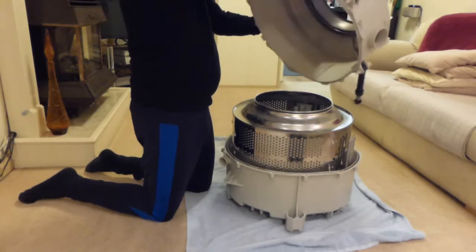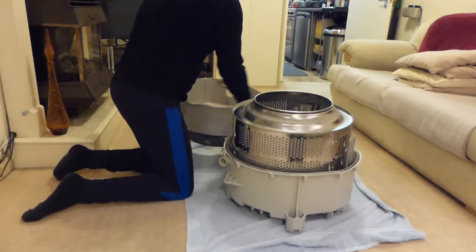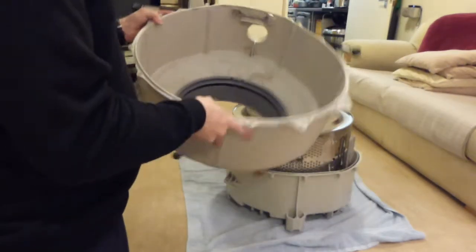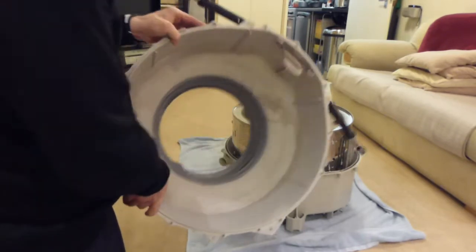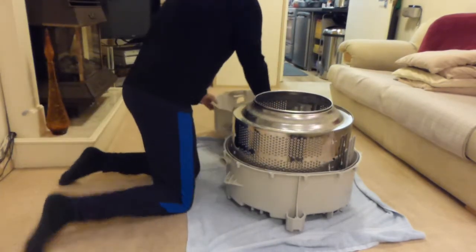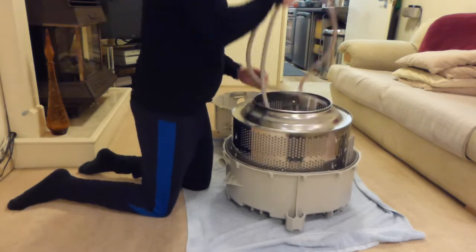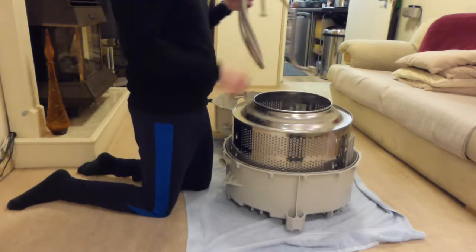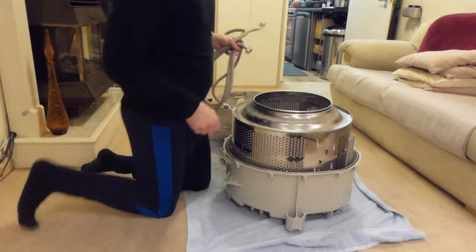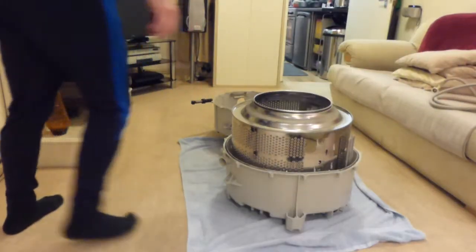So there we have the one half of the drum removed, and we can see inside there, that's fairly clean, really, considering that this is 11 years old. I always have tried to look after the machine, but now this is going to be the revealing part, because we're about to have a look at the spider on the back of the drum. And this is the part that quite often fails, especially on American washers, the large capacities. The spiders were failing very, very quickly on some of those machines, corroding through. The spider is the weak point on the front loader.